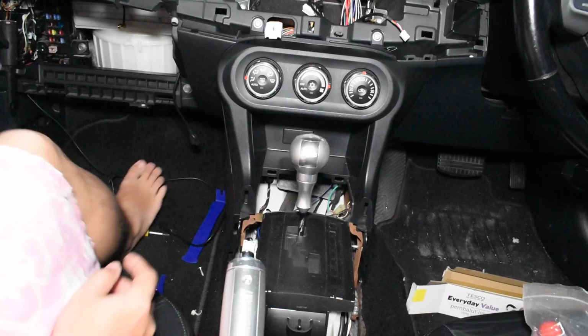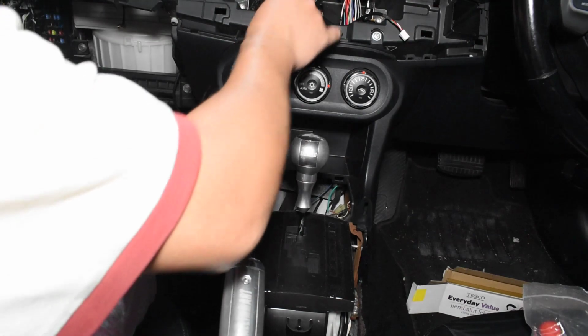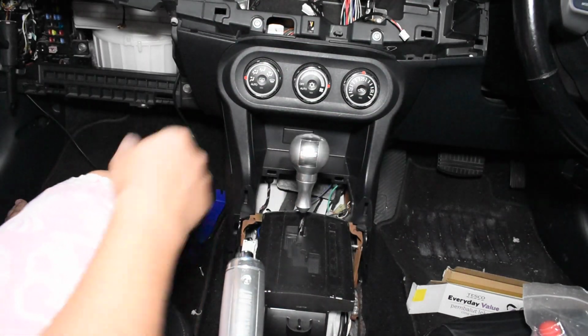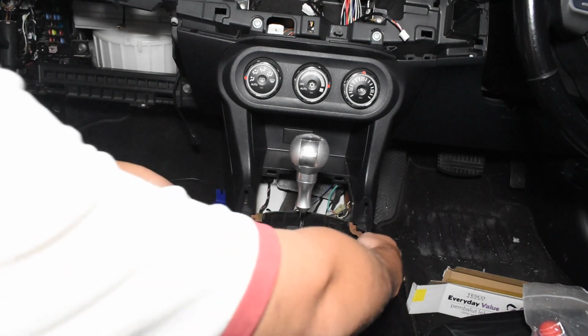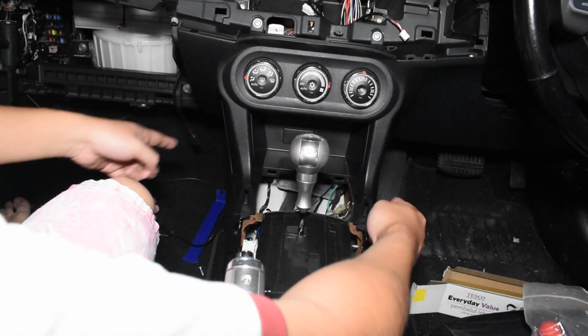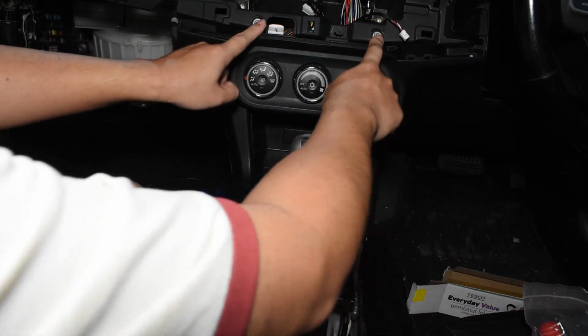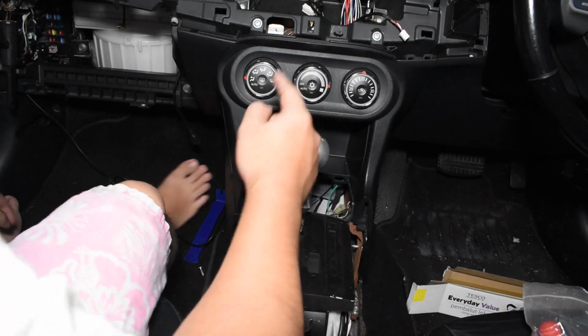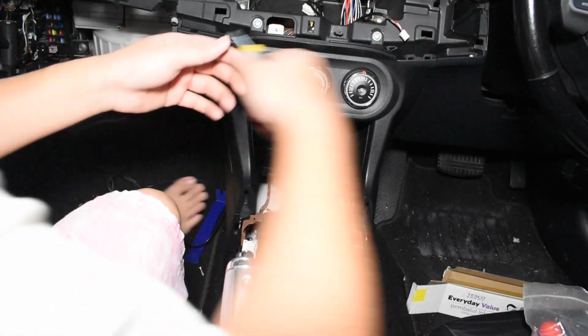Okay, so I've gotten asked by one of the subscribers how to remove the aircon switch panel. Alright, so there's two screws at the bottom here, two screws at the back. I'm not sure whether you really need to remove those two screws at the back, and then two screws on the top here. Alright, so once you remove these two and these two, you should be able to take it out. So let's give that a try.